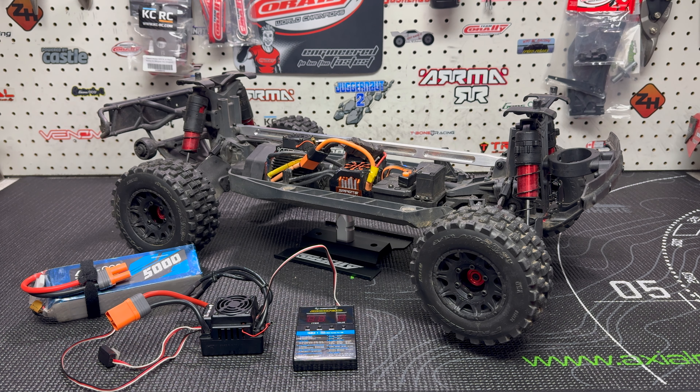In this case, what we're going to be doing is running 5S, so we're adding more volts to the motor. Motors are based on RPMs, and to a point, you would never want to take some teeny little motor that does a hundred thousand RPMs and dump 6S or 8S into it because it's just going to fly apart. But a lot of motors, they're based off an RPM, and when you do the math, there's always tons of room to go. I've gotten away with this a lot - I ran my Traxxas Max on 5S, even tried it on 6S a few times with no issues. So in this video, we are going to get that ESC installed, swap out the Firma 150 that didn't allow me to turn off the LVC, and we should be able to run 5S and head out for a quick blip.